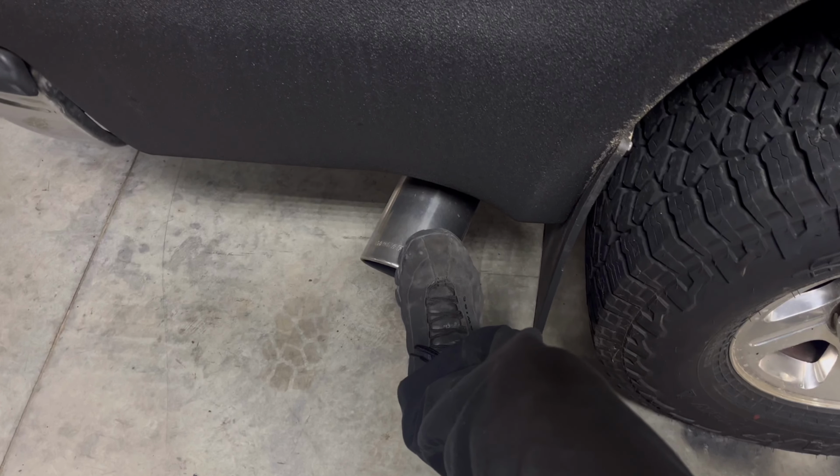We saw two of them. Yeah, and both of the ones that I got had those grind marks on it. And you have to admit, when somebody goes grinding on metal, a casting line disappears when you grind on it. A crack does not. And when those are ground on, the casting line did not disappear. So I agree to disagree.